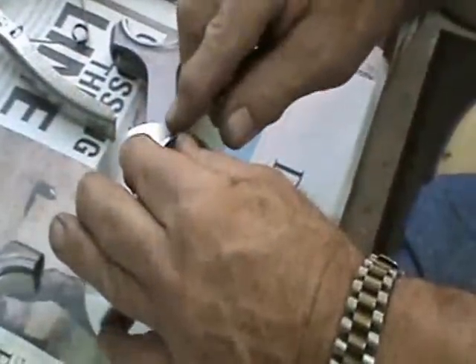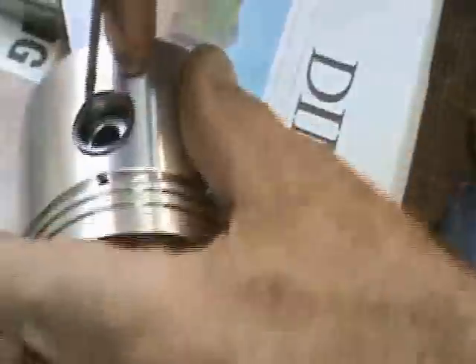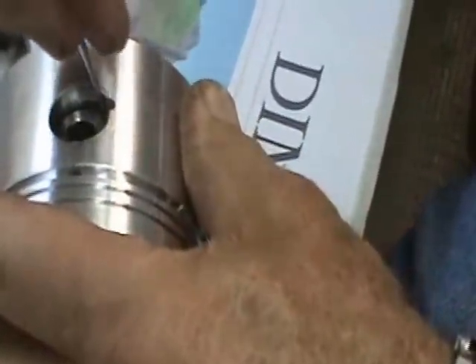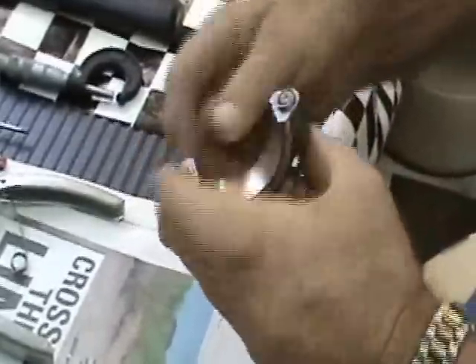That's good practice. These are so-called spiral locks, a little different than just a snap ring. They're a little more difficult to put in and really difficult to get out, but they never come out by themselves — there's no danger of them accidentally coming out. You spread it a little bit to get it started and then go around the circle pushing it in place, spiraling it into the groove. You always want to check and make sure you didn't forget one. Then we're ready for the rod bearings to go into the cap — we've measured them with our ball mic to make sure they're all the right size.